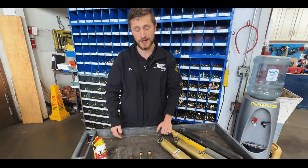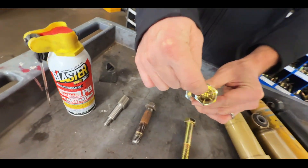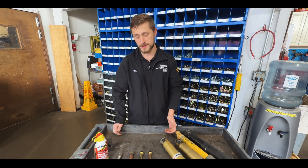Use an impact wrench, but watch out — especially for those fine thread bolts. I myself replaced the shocks on a W series and I thought I was going to have to cut that bolt off because it just started hanging up. I had to use a three-quarter inch drive impact wrench to slowly hammer the thing off and get it loose. If it starts to bind up, try hammering it for a bit and then backing it off. Be prepared, especially if those fasteners are rusty, to replace that hardware with new stuff. We recommend always using grade 8 — you can tell grade 8 by the six lines around the head of the bolt.